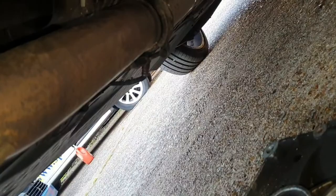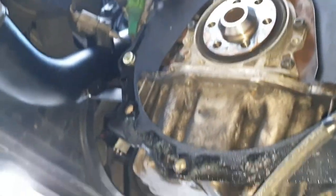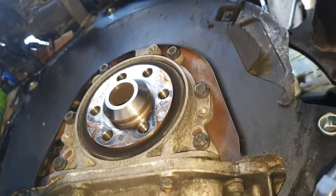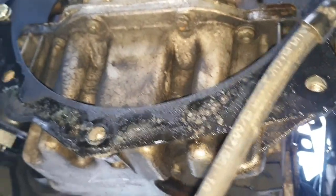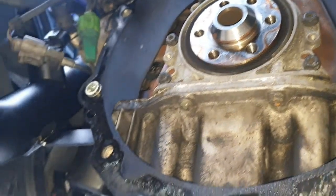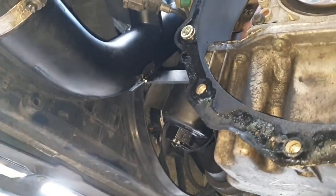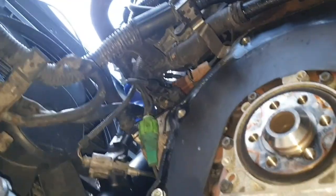It's quite loud, but it keeps leaking every now and then, so I always have to reseal the exhaust. I get some loud backfires from cold. When it's warm it's fine, but when it's cold you can hear it blowing and you get a lot of popping and banging, which is nice, but it's not genuine. It's just an air leak type, so I'd rather not have it.